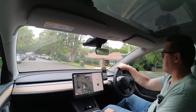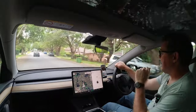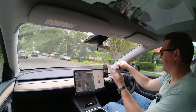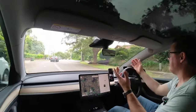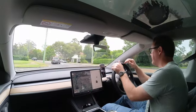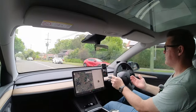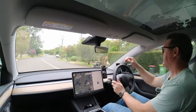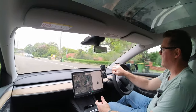We will be measuring the tread depth on each tire — the inside and the outside. Then I'm going to put the car on flat level ground and jack up each side of the car, doing one side at a time, swapping the rear to the front. I always like to do that as the first rotation. That's a bit easier for me rather than trying to jack up the whole front or whole back of the car and end up with all the driving wheels off the ground. I'll take it to a shop on the next rotation and get a wheel alignment done at that stage.